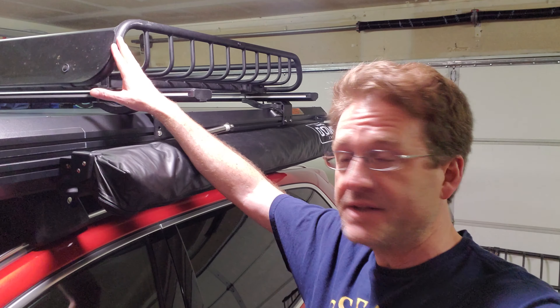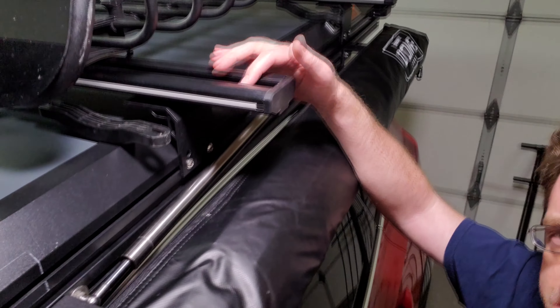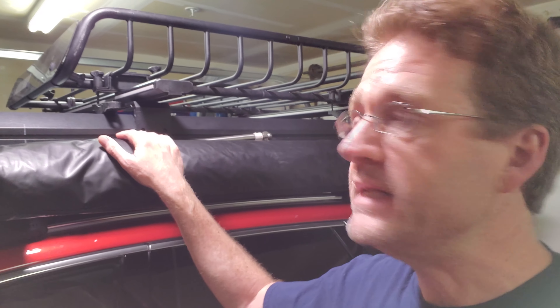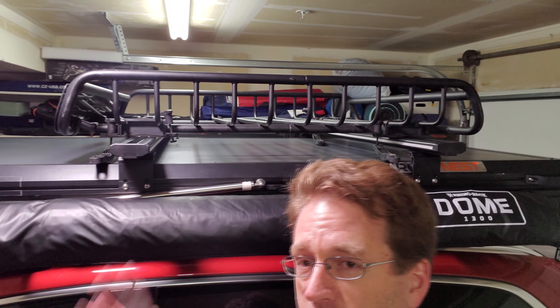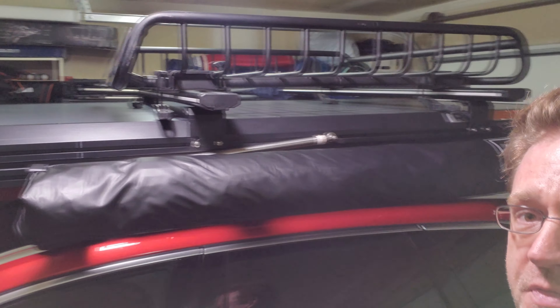So I went for a test drive without the basket — the basket won't actually fit through the garage door opening — and I had a bit of a wind whistle. I think it's because these rails have huge gaps both on the top and bottom, so I'd want to gaffer tape those up and that'll probably take care of it. Then I put the basket back on in the parking lot and tried to open the Roof Nest roof. It went up about 80%, but then essentially stopped and certainly didn't make the fabric of the tent nice and tight. To get around that, the basket was supersized, so I took out the midsection, which reduced its size by about a third, and also moved the back rail forward by about 10 inches. The overall weight is moved forward and reduced by about a third, and now it opens up nice and clean — no problem. Got that solved.